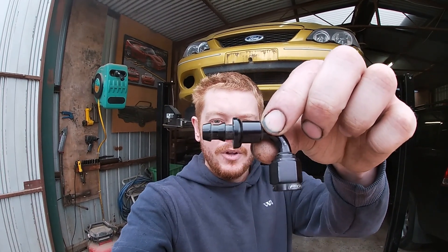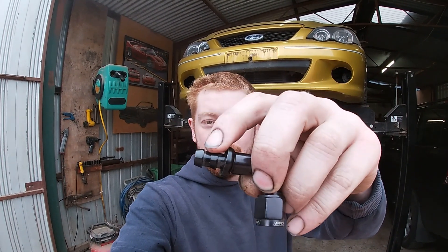If you don't know what push lock fittings are, there's one there - they're just like a really aggressive barb, and when you use the right size hose it's a really tight fit, really hard to get on, and you don't need to run a hose clamp with it. They work fine - this has been together for like seven or eight years, I've made like 25 passes in it, lots of burnouts.